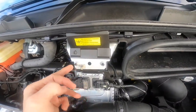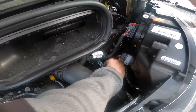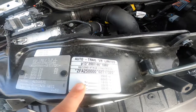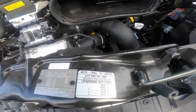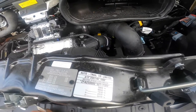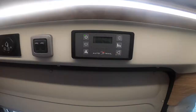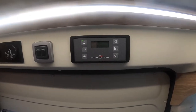You've got your paint code — 611 for the Grigio Aluminium. There's a negative earth and a positive behind the headlight. If the cover was down, just put the key in, lift it up and there's your positive. This is a secondary stage conversion weight plate — this is what you go off. Three and a half ton gross vehicle weight. If you put a tow bar on, your train weight — that's the motorhome plus whatever you're towing — can't exceed six ton. You've also got your front and back axle weights.